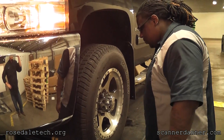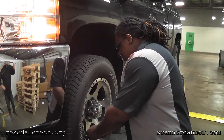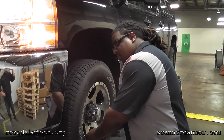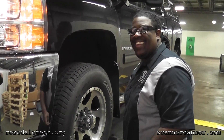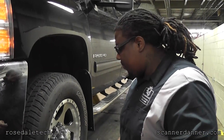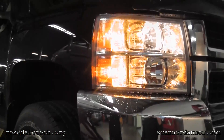Take that tire cap off Philippe, then take a pocket screwdriver and start letting air out. Did you hear that beep? What that did is the computer basically noticed a tire pressure drop on the left front and said okay, that's where the new tire is. You can leave that cap off because we've got to put air back in it.